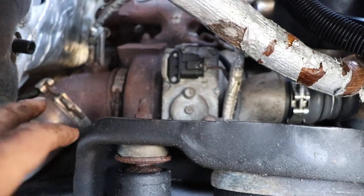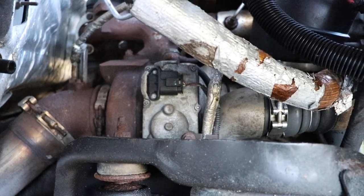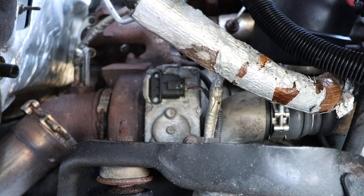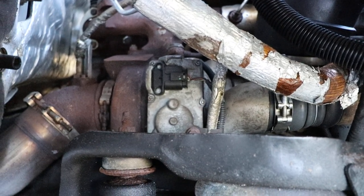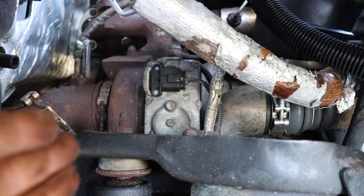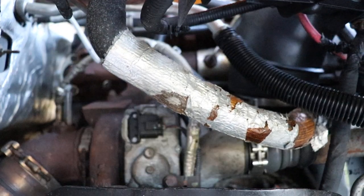In the end I had to get the turbo out. The used one I bought was from 2014, and it turns out that turbos sitting will lock up on their own just from moisture. The guy I bought it from seemed decent and it should have been a working turbo, but it's intermittent — it's actually locking up on the full exhaust brake end of things, creating a ton of pressure that could blow my head gasket.